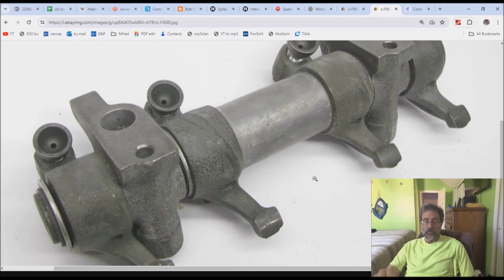Now, the purpose with a Subaru is to squirt the oil not at the exhaust valve guide and the support for the valve guide, but they have an interference fit spring system, so that as the springs bounce next to each other, they have a tendency to dampen out vibration, helps on a whole bunch of different things. It's not for strength, it's for vibration dampening. But because it has an interference fit, you're not trying to lubricate it, you're trying to cool it. The interference fit creates heat. So they're trying to throw the oil at their dual spring system to keep the springs cool. It's a water-cooled head, you don't really need to play around with the exhaust valves and the guides.